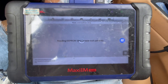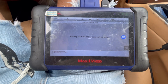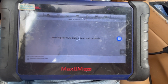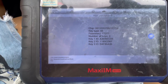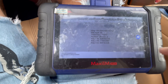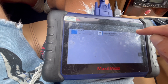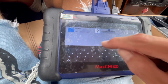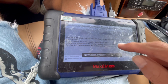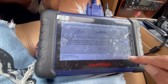After waiting for approval, it goes to a new screen that says 'reading EEPROM.' We got the reading — thank God. After getting this, we just hit OK and it loads the EEPROM. Save the file — I'll add a label so I remember where it is. Now you can generate with this key data. Just going to hit OK.